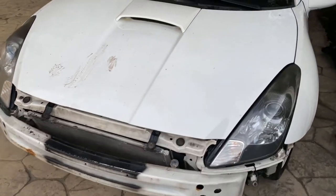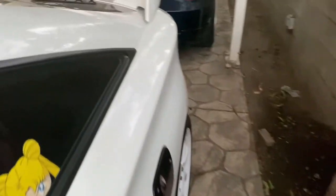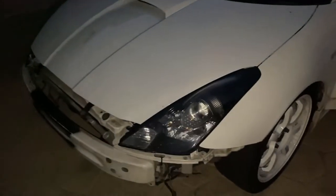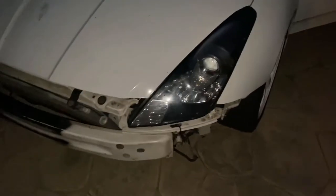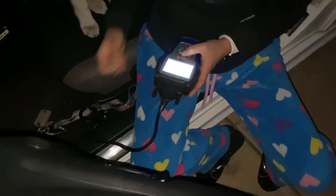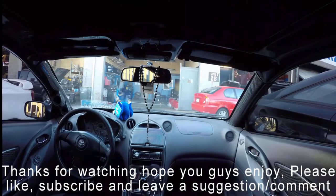Hood's already on, going for a little test drive to see how it does. We went for the test drive — the clutch is biting all the way to the top, so I'm going to try to adjust it and make it a bit stiffer. Also a check engine light came on — I don't know for what — system's running lean again.